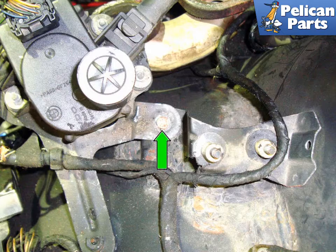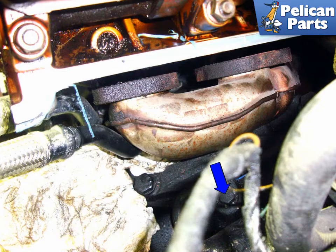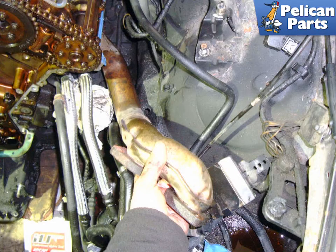If you choose to move the power steering reservoir, please follow the link provided at the end of this video for additional assistance. With all 4 fasteners removed from the front left side exhaust manifold, lower it off of the exhaust mounting studs by moving it in the direction of the blue arrow. Pull the manifold out of the engine compartment by the front. You will have to twist and maneuver the manifold to fully remove it. Removing it makes it easier to remove the rear cylinder's exhaust manifold.